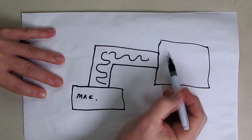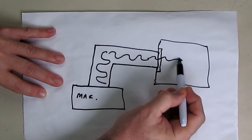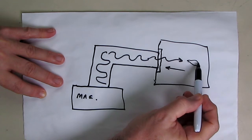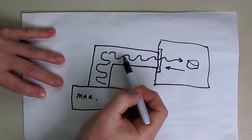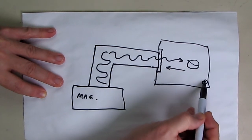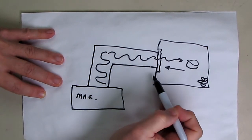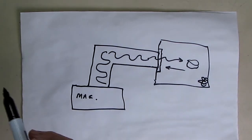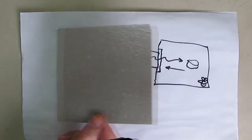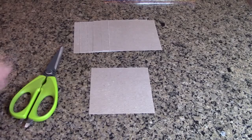Now you don't want dirt and debris in here. So this mica cover allows these microwave energies to exit, and it doesn't allow them to come back. So that way they absorb into your food that you have on your platter, but they don't go back into the electronics. And what happens is oil and debris, even though there's fans in here, oil and debris, and moisture will eventually break this down. And that's why this mica panel starts to break down, and you have to replace it occasionally. So that's where this comes in. You cut it to the size you need, and you replace that panel right there, and your microwave starts working again perfectly. So it's very simple to do.